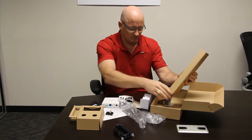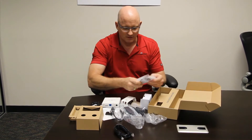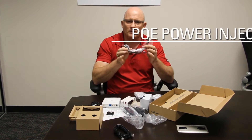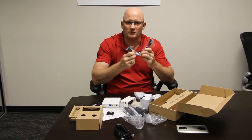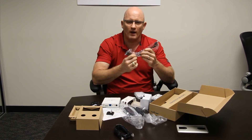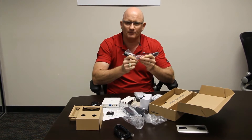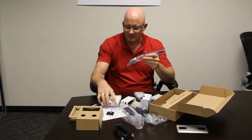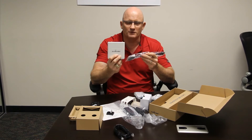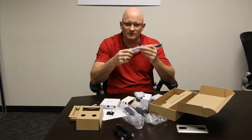There's also an ethernet cable, power, and the antennas. The really important item still in the box is the PoE power injector — this comes with every unit, you don't have to buy it separately. It allows you to place the unit anywhere in the facility using remote power over a standard ethernet cable, so no native PoE adapters are needed. No devices I've ever seen have PoE on a WAN port, so we need to provide that. Everything you need comes in this box.